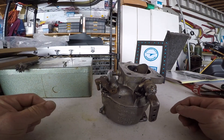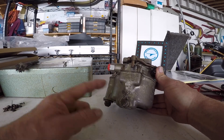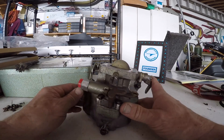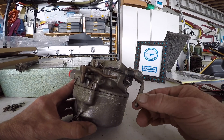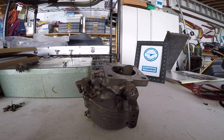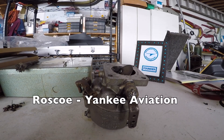Setting carb idle and setting mixture for idle — these are the adjustments we have on our aircraft. Down here is the drain plug that we can pull out to drain the carburetor bowl every year. This is your basic carburetor. Everything's pretty much marked richer or leaner for your knobs. You turn the throttle in to push it a little bit more open. We hope you found this useful and informative — thanks for watching, and have a good day flying your Grumman.